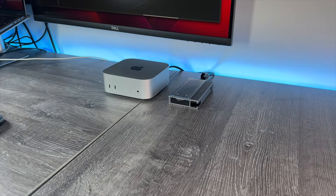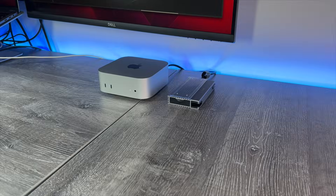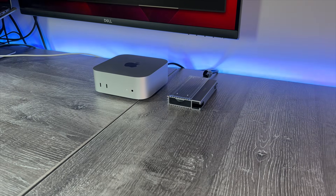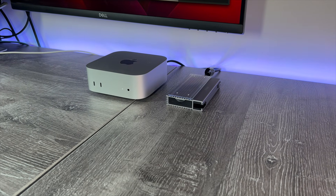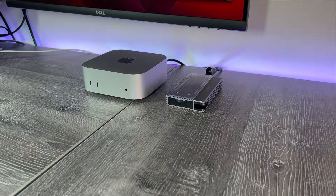I'll drop those links below so you can go and compare the current prices on all of this hardware. Personally, though I like the build and aesthetics of the Ugreen, I'm going to use the Zike drive unit — and this is because this machine will be used for audio recording and the fan on the Ugreen is audible enough that it could cause me a problem with noise pollution on my recordings, as well as those additional moving parts that could fail. I would pair it with the Samsung 990 Pro for the reasons I mentioned, and in this configuration the Zike performs well if not even slightly better than the Ugreen. The Zike suffers really only in high stress conditions for the drive which you're not likely to hit during regular use, so in most cases performance will be very similar and the fan noise really becomes more of a deciding factor.